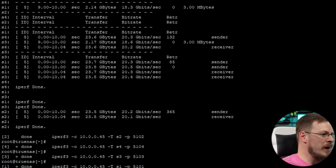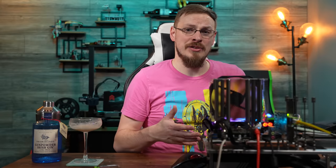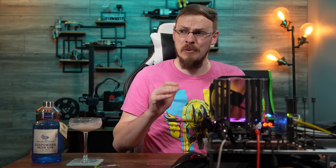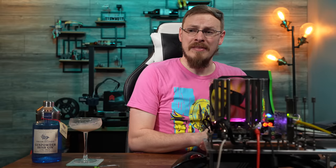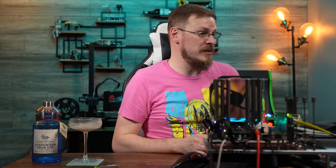What happens if we only run one stream? Are we going to be at 25 gigabit? Because I saw a number of comments on Twitter saying, well, a 100 gig connection is just four 25 gig connections. And you're kind of right, but you're also not. According to the MikroTik CRS504, this is just four bonded 25 gig interfaces. In fact, it shows up as four separate interfaces in the switch.